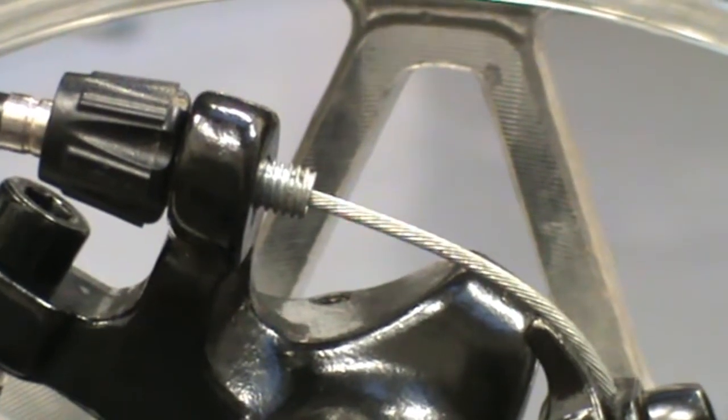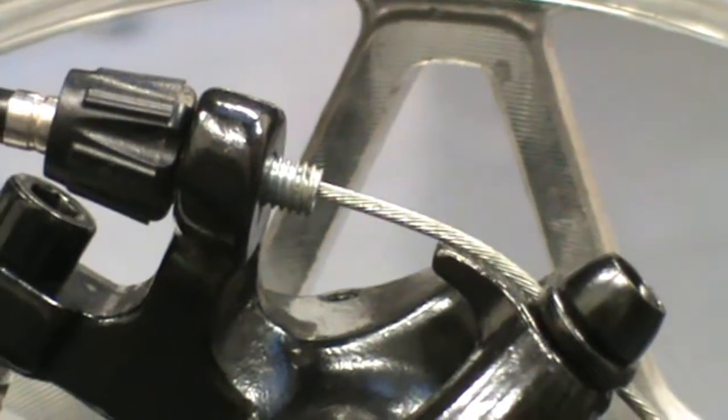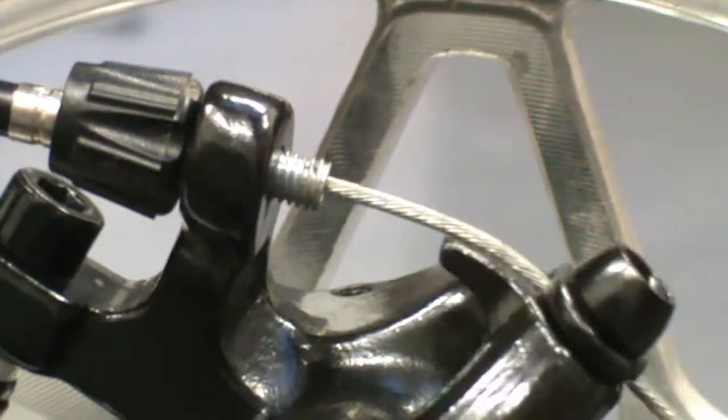Hopefully, by adjusting the far brake pad, if I pull the lever now, it should have a good centimetre and a half of clearance. We've got about a centimetre — it's not bad. That's made all the difference there. I'll show you what that did at the brake lever in contrast — it's over a centimetre, and it's good.